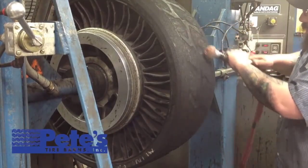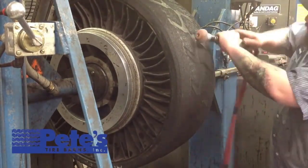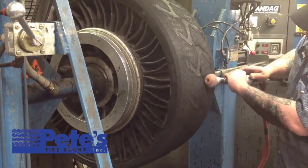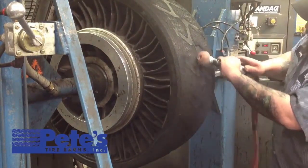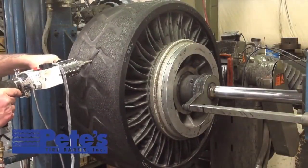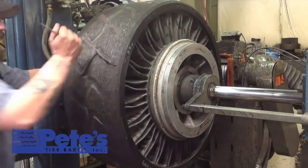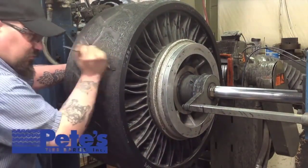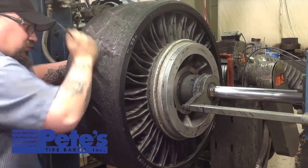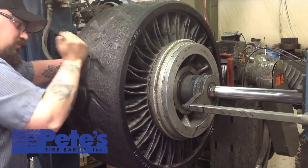Once the initial inspection is complete, the tire moves on to the buffing process. This phase requires the use of specialized equipment designed to delicately remove the existing tread and any imperfections from the surface of the Michelin Tweel. The goal is not only to create a smooth and uniform surface but also to expose the underlying layers for the subsequent application of new materials. Technicians carefully control the pressure, ensuring that the buffing process is thorough without compromising the integrity of the tire's structure.